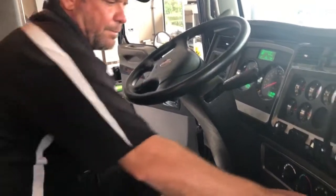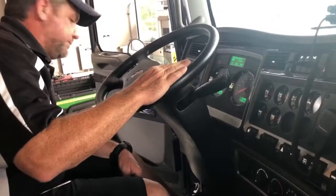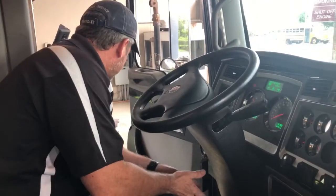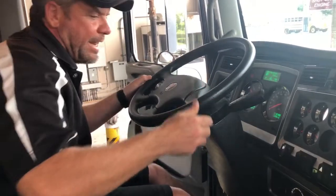Push in the red button anyway — I'm going to roll forward a few more feet. Clutch in, hit the brakes. The truck should stop with my brake pedal, and the wheel should not pull left or right, which would indicate I have an out-of-adjustment front brake.